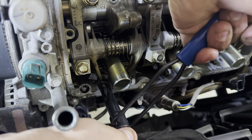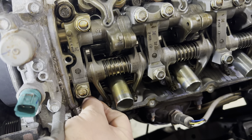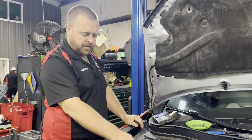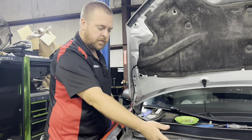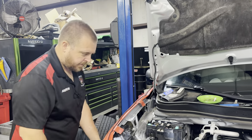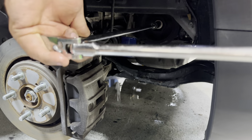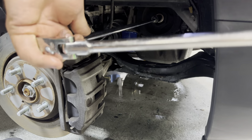That's pretty good. We're good on that cylinder there. For the sake of time, obviously you would continue on, go around each rotation or each mark on the camshaft, and make the adjustments to the associated cylinder. Once you get through that, what I like to do is rotate the engine around — keep in mind that in order to get back to the compression stroke, you've got two rotations to get there.